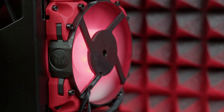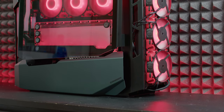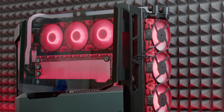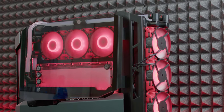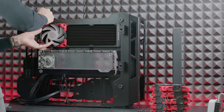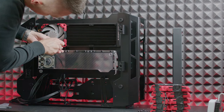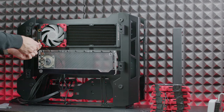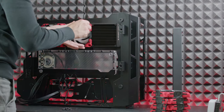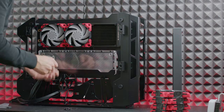Slim triple fits perfectly everywhere. Since we're already talking about radiators, you have quite outstanding space at the back side of the case, and you can see from the close-ups how I placed the FLT 360. The FLT 360 can be mounted in two ways because the brackets you get are quite short — at the part where the pump goes, you can squeeze in the pump and use the shorter brackets, making it more in line with the fans and radiator on top.